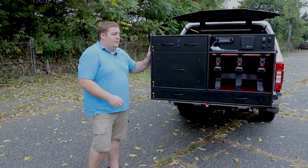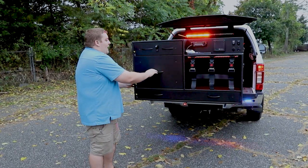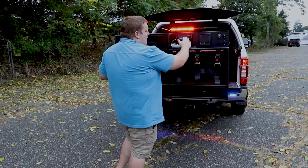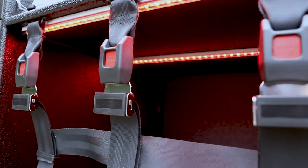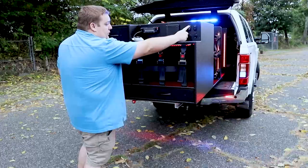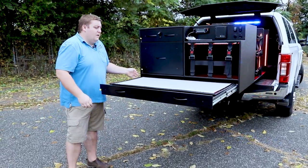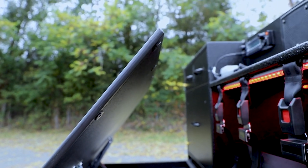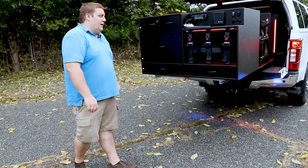We've got a 72 inch slide-out cabinet. Up front we have a lockable parts drawer, and below that a larger parts drawer. We've got our radio faceplate with our radios, our speaker recess cut, some switches, and some 12-volt USB. In the compartments we've installed Amdor dual color red-white lights so they have the ability to change between the two colors or turn them off. Down below we have a custom ratcheting magnetic command board — a full width, full depth board that gives them plenty of writing surface. They just lift up to ratchet down to close, and it closes utilizing the Accuride 9308 lock-in lock-out slide.